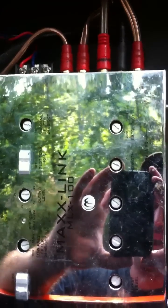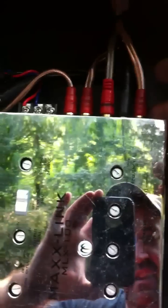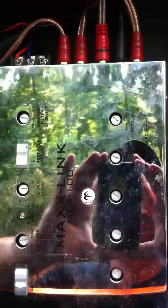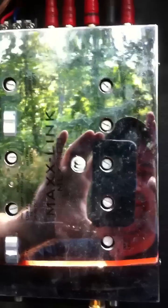You can run up to ten amps off the MaxLink. The first five on the top would be a positive signal; the back five would be negative. The first five you're going to wire normal — positive and negative out of your output into your speakers. The other five, if you decide to use those, you need to wire them reversed — negative and positive.